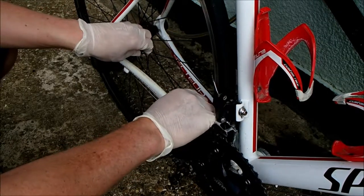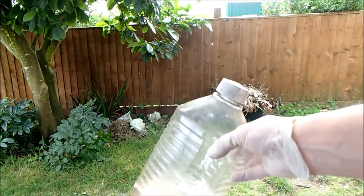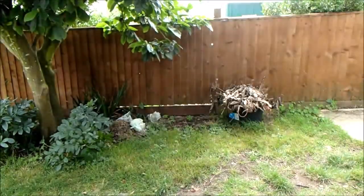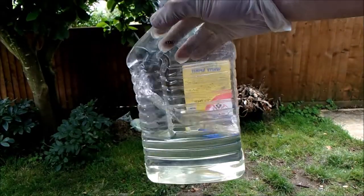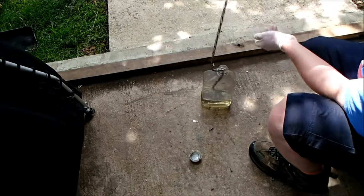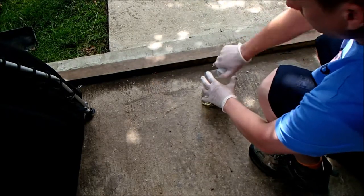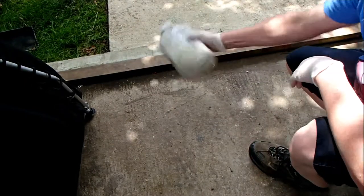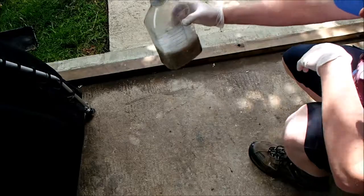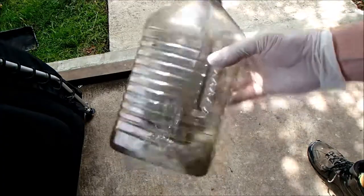There's a quick release on the chain — self disassembly. I use two different pots: one contains dirty petrol to clean off the initial wax and most of the crap stuck to the chain, and the second bath is a clean pot of petrol which obviously gets less contaminated than the first bath. You can see after just a few shakes the dirt coming out of the chain — it's really discoloured the petrol already.